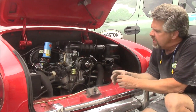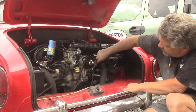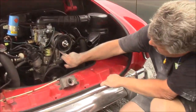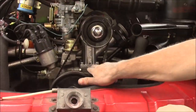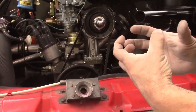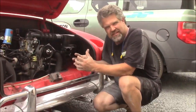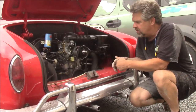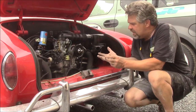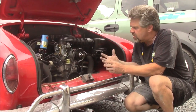So what's happened is, if you recall in some of those videos when we had this oil filler, on top of this or below the generator we have the oil filler tube, and there is a picture with this off, and there's a little plate with a vent, and it had all kinds of carbon buildup and burnt oil. It was really nasty. So it had terrible compression. It didn't have proper air or oil cooler filter. It didn't have proper flow. There was a lot of scoring in the piston walls and cylinders and piston rings.